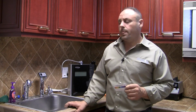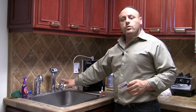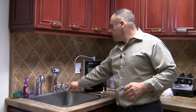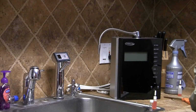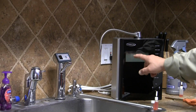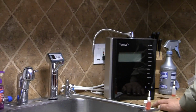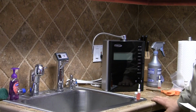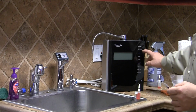highly recommend that. As far as getting the machine set up, we have our install done with the G2 faucet installation method, and we have our water supply completely open, so there's water pressure going over to the machine. Now you'll notice with the M.A.X that after 1 minute the screen times out, and this is called the sleep mode. So the screen will be black. So whenever you walk up to the machine, any button that you press on the panel is going to wake it up out of its sleep mode.